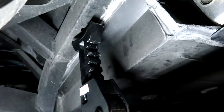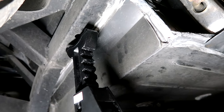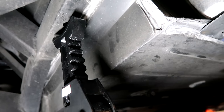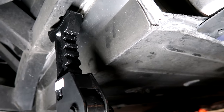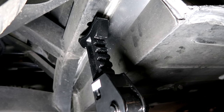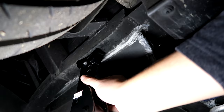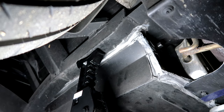I've got the jack stand in sideways because I don't want to pinch that rubber seal, but if the car were going to fall I'd rather have it land on that solid frame rail than on my head. I'll lower it just enough so there's a small gap — the jack is in place and it's not going anywhere. That gives you full access with both the jack stand as a safety measure and the jack supporting it on the side.